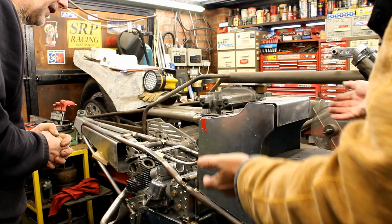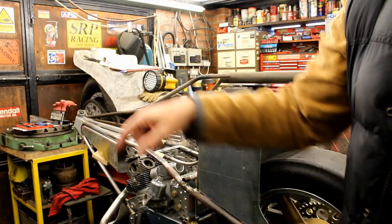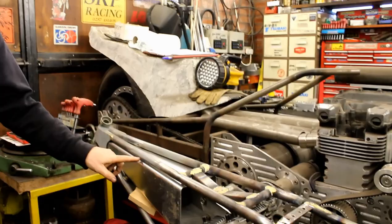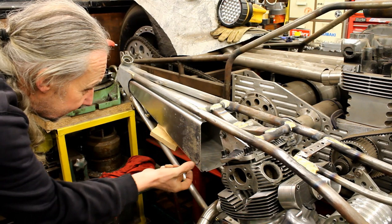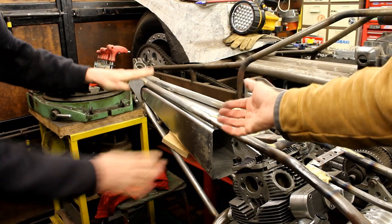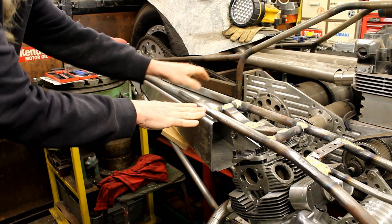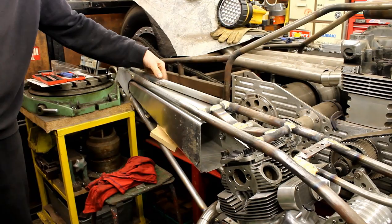The tank was folded on that brake folder. It's also got to be cut a little bit more yet - Jeff has it marked to trim with a bit of a curve. A filler cap also needs to be added. They've decided the filler cap should go on the side rather than the top - if it's too low you can't get the cap on, if it's too high you can't get the tank off. So it's going on the side for practical reasons. A lug mount also needs adding - a piece of inch tube brazed on.